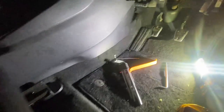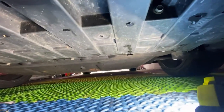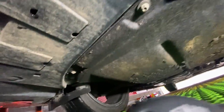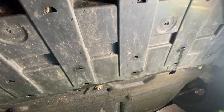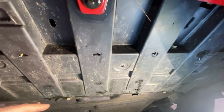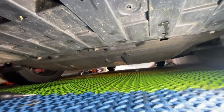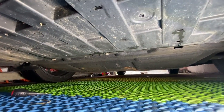So that's the cabin filter done, air filter done. We're also just changing wiper blades - straightforward. Then we've got to do the oil filter and oil change. Down at the front of the car, I'm going to take off four Phillips screws at the front, drop the tray down, and hopefully be able to get to the sump without having to jack it up.